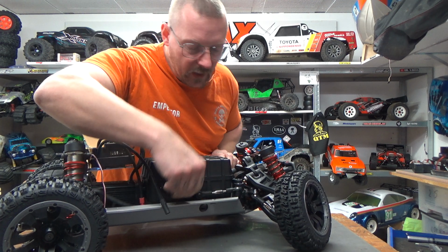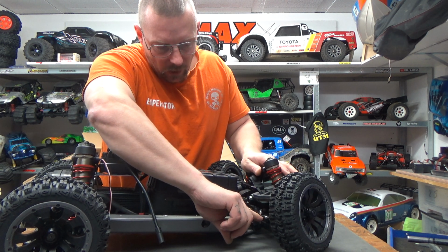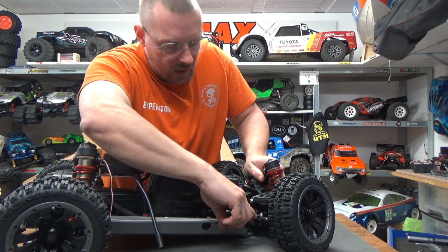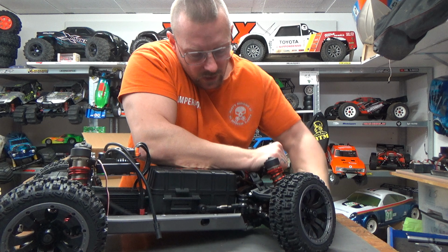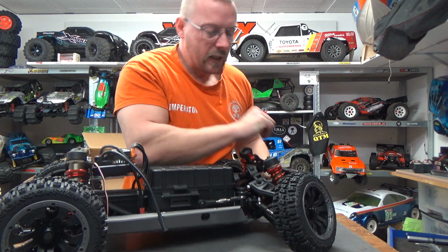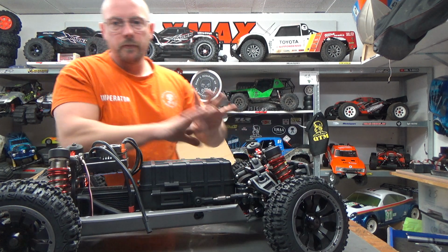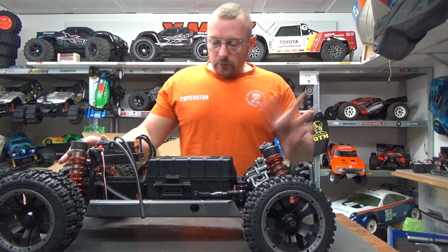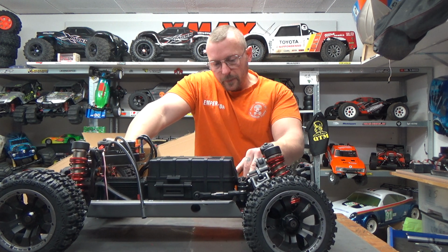Because what happens here is that when the suspension goes down, you see, this part touches here and stops the suspension travel. You can go down, but it squeezes this little alloy plate or steel plate that is only 2 mm steel. Look what happens. I can absolutely bend it. The whole thing moves out, and I'm really not able to use the full suspension travel. Looks strange here on the table. We'll see what happens when we drive. I hope it will be fine and we have no issue with that steering.